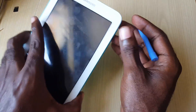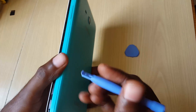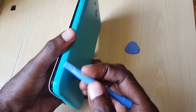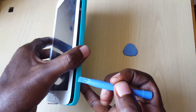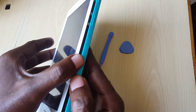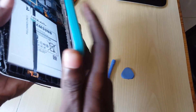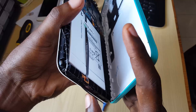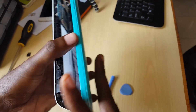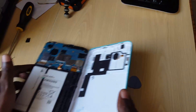Make sure you get into the grooves — the idea is to lift the sides until the panel is open enough around the edges. Don't be fooled by a section that seems to be a groove; it's actually closer to the screen. When you finally get it to separate enough, you'll have to force it apart. There are some glue strips holding the halves together, so you have to apply some force.